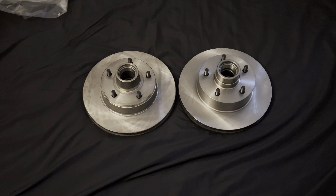With this car, the front disc brakes are already in. The rear had drum brakes, but I'm doing a rear swap that already has disc brakes on it. I decided to do the rear swap because I already had the rear end. If I had done a disc brake conversion, between parts and labor it would have been around two grand. By doing the rear swap I saved money, and it already has an 8.5 rear instead of the factory 7.5 — a win-win.